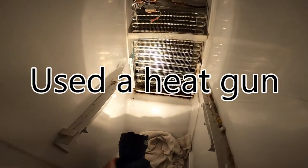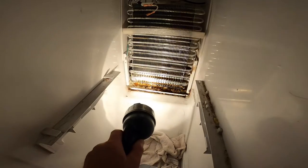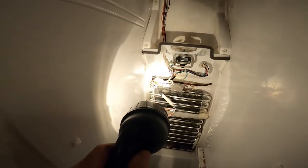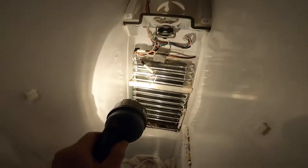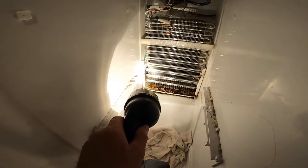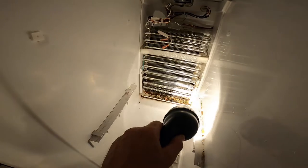So I got things defrosted, now I can see things. That paint there is just paint — those things that look like potato chips, I don't know if it's because of hard water or whatever caused that to flake. Now I want to see why this coil is not working. Everything looks okay with the thermostat up here. I have to get this thing into defrost mode and see if it's actually working, or maybe test the resistance. That's my next move — to see why this thing is not defrosting.